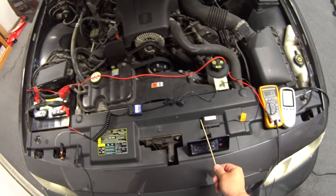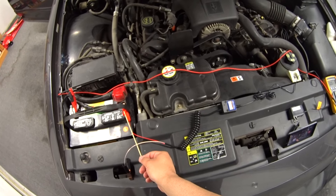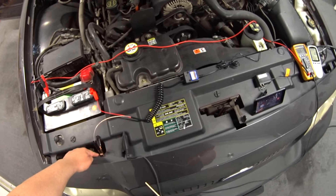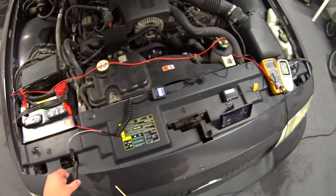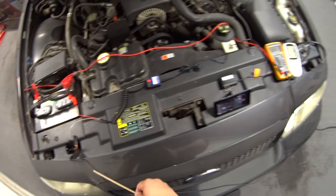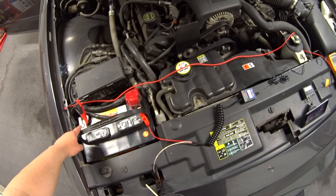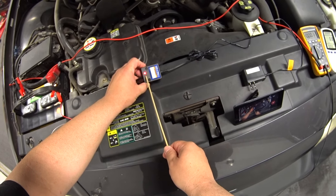This is the charger — here's the little LED status light that comes on when it's connected. I've got the positive cable to the positive terminal on the battery, and the negative clamped onto a non-conductive part of the car. That's because I'm connecting the negative part of my meter there, and the electricity will flow through that wire, through the meter, and out the positive meter lead to the negative side of the battery so we can see the current reading. When I make the connection, the status light comes on.